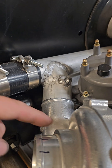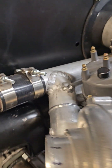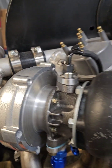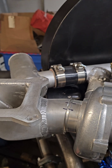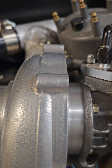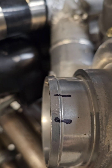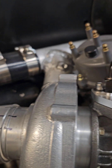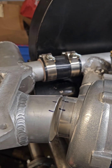What he's waiting on — I did all this, lined it all up and lined it perfect. Look at that. But I need to do this right here, it's going on right here, as you can see I already made some marks. The problem is this has already been ceramic coated, so I need to take it up on the lathe and cut off the ceramic coat so that this guy will butt up against it. And the more I mock it up, I kind of want to move it in even closer, so I might trim it back.